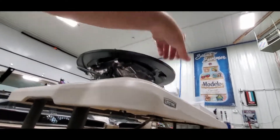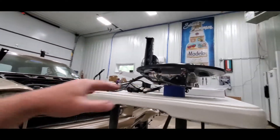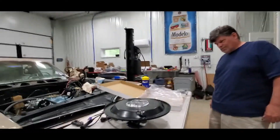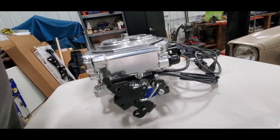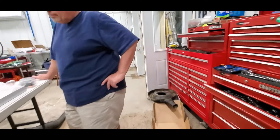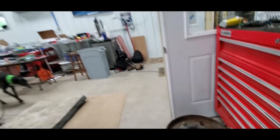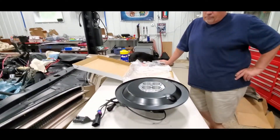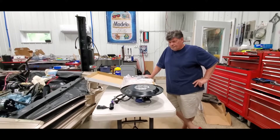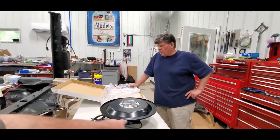People who've seen the corvette videos will remember we used one of the low ports for our fuel feed, which is what we're planning to do here as well — you can see how much lower that is, making it easier to clear the cover. We've ordered an El Camino cover or something similar, and when it comes we'll see what it does, cut out what we don't need, trim it, do a little stitch welding, epoxy it and paint it up. No one will ever know, but we'll still get a nice quiet snorkel style that looks correct and hides the EFI.